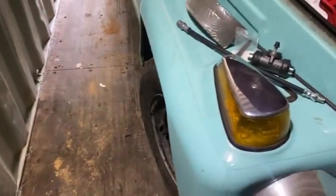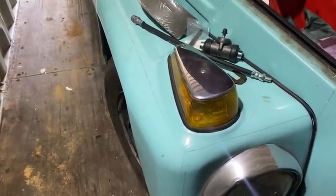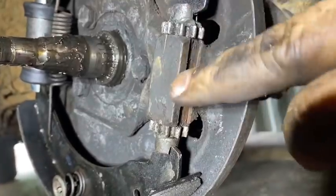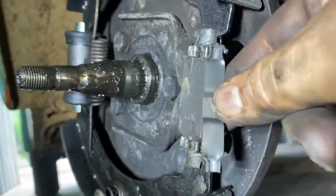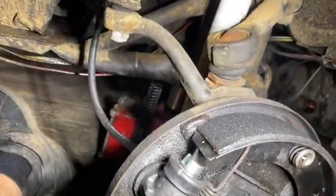I'll get the thing torn apart again today, finish the brake job on this side, then move it over — it's in the container up against the wall — and do the other side, so both front sides have new brakes. The bottom of the hold-down was broken. It's really easy, just one bolt through the back. Then knocking out the rest of the broken clip — the little center section just gets punched in. It's got a groove, it's steel, and you put a punch over the edge and it holds into place. That's what keeps the adjusters from spinning.